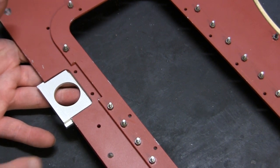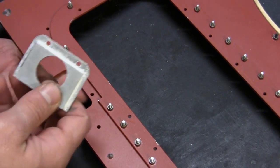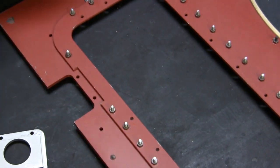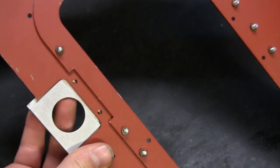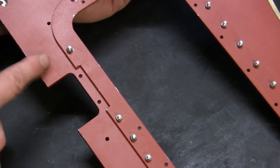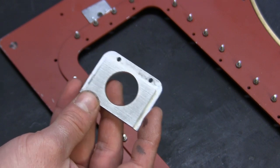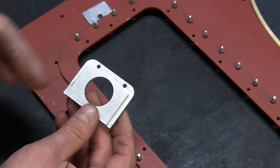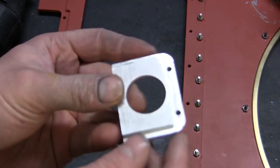However, one small alteration needs to be done on this generation of King Tiger. You need to make a slight modification to the corners — they are a straight 90-degree cut, but you do have to add a radius to them. This is relevant because on the top deck there is a radius present, and if you line up the piece, it won't lock in all the way because it bottoms out on the curves. You can address this one of two ways: either take a square file and put notches in on the top deck plate, or do what I'm going to do and add the radius cuts to these pieces using a Dremel with a high speed removal bit. Here's the same plate with one radius cut added, and with a pencil I've marked exactly how much material needs to be removed.